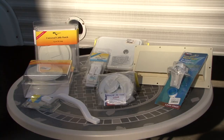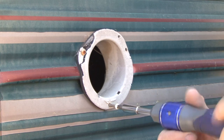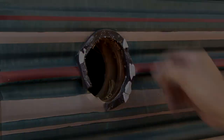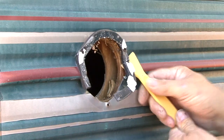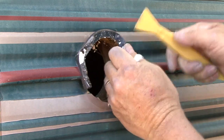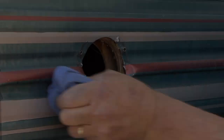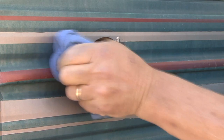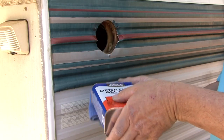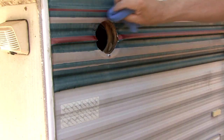After a thorough inspection, we purchased our replacement parts. It's going to take a while to replace all these parts, so we better get started. The first step is to remove the old damaged parts and clean the surrounding area. I use tools like these plastic scrapers to remove old butyl and putty tape or foam gaskets. Clean the area using a cleaner compatible with the surface you are working on, and as a final prep you can use denatured alcohol on a clean rag.